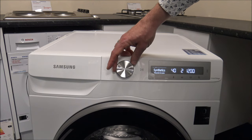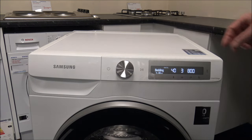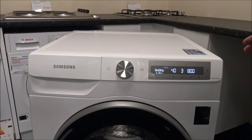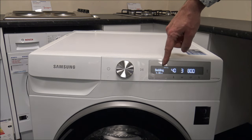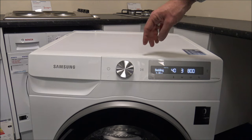There's a huge number of programmes: synthetics, delicates, towel, bedding. Some people wonder why they'd want a special bedding programme, but what they will do — apart from washing differently — is spin very differently as well. A lot of people tend to underload their washing machine, putting in things like a bath mat, bed sheet, or duvet cover. Pretty much all washing machines struggle to spin at the end with these items. The bedding programme tries to redistribute the load towards the end of the programme in a different way to the standard cotton or Eco 40-60 programmes.